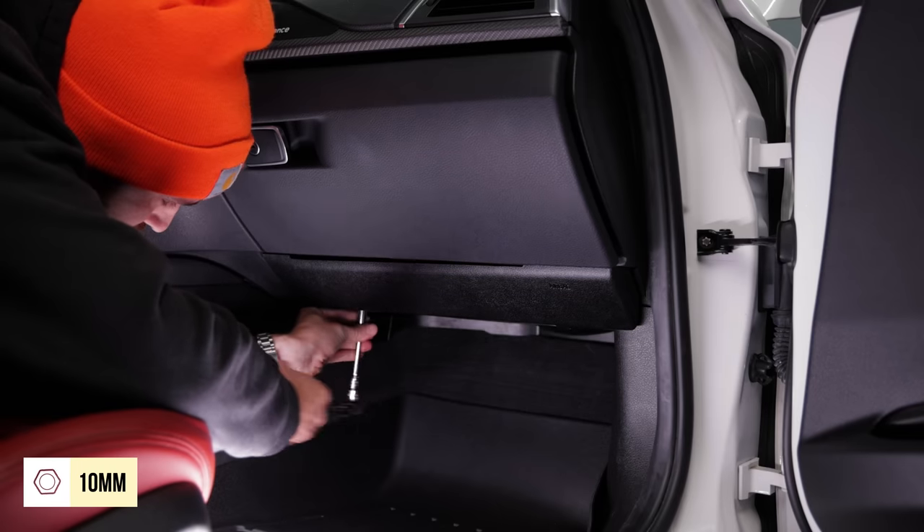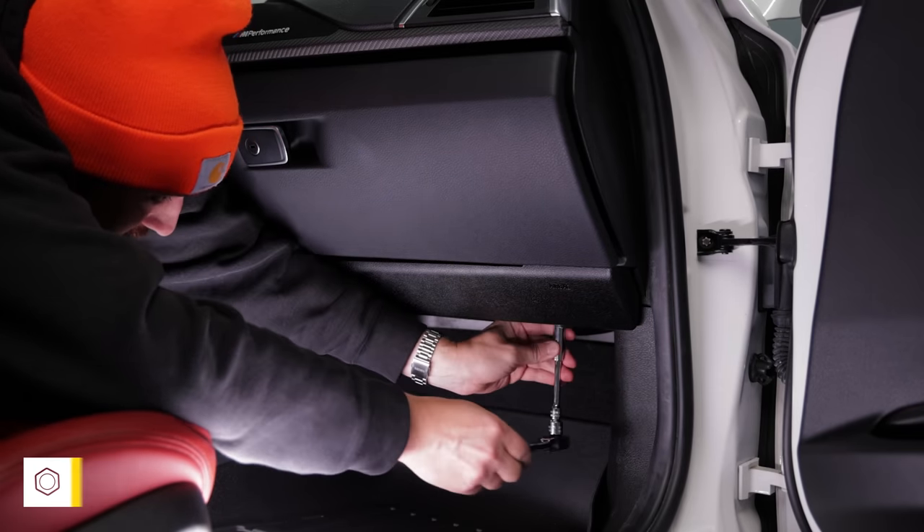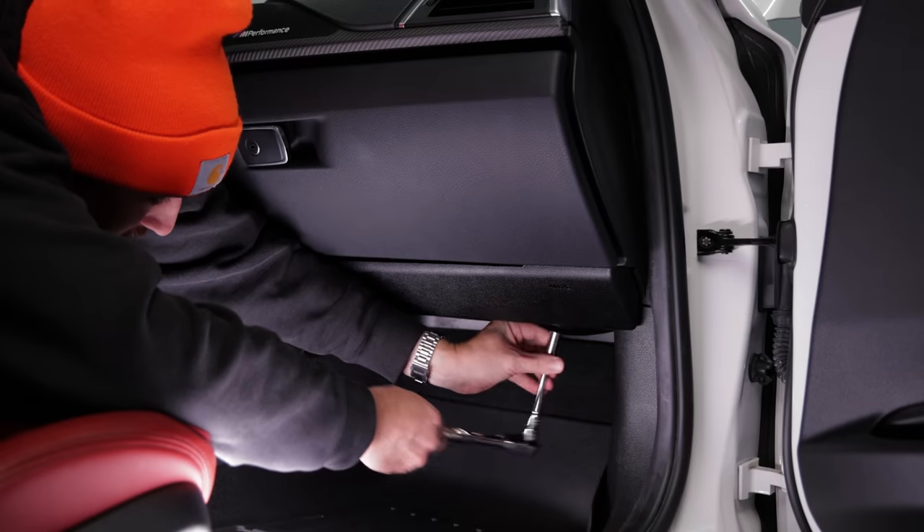Since I'm going to be using the heat in my car for the next six months or so, I want to make sure my cabin air filter is good to go. On the F30 it's going to be in the passenger footwell underneath the glove box; on the E90 it's under the hood — I can link my E90 cabin air filter video below. Remove two 10mm nuts from the footwell — whoever did this last time never put them back in, so I'm pretending to take them out in this shot.